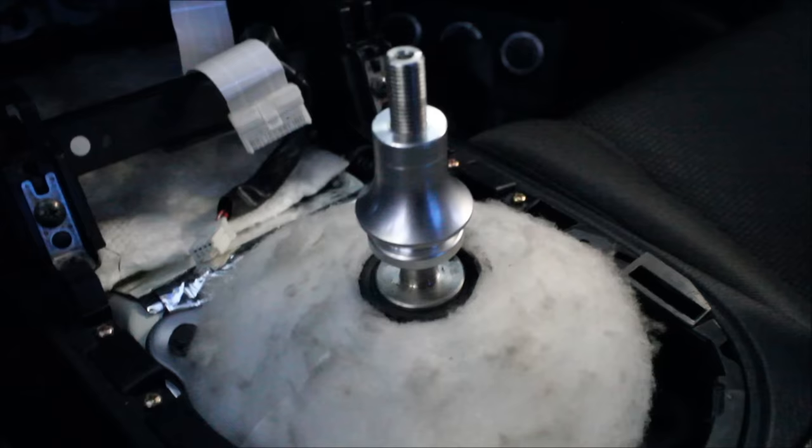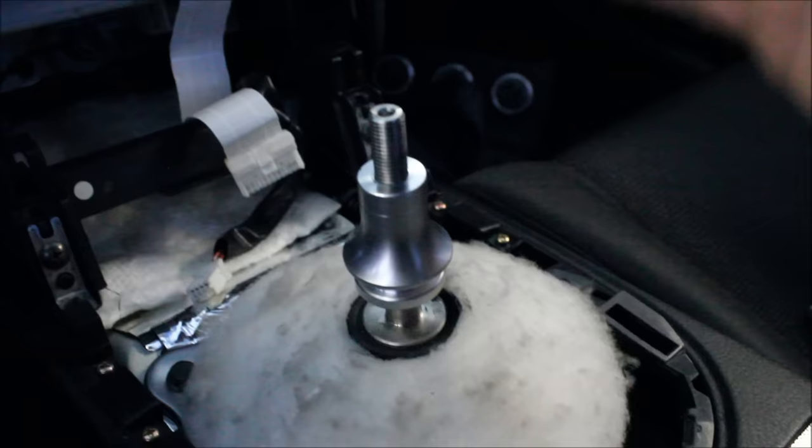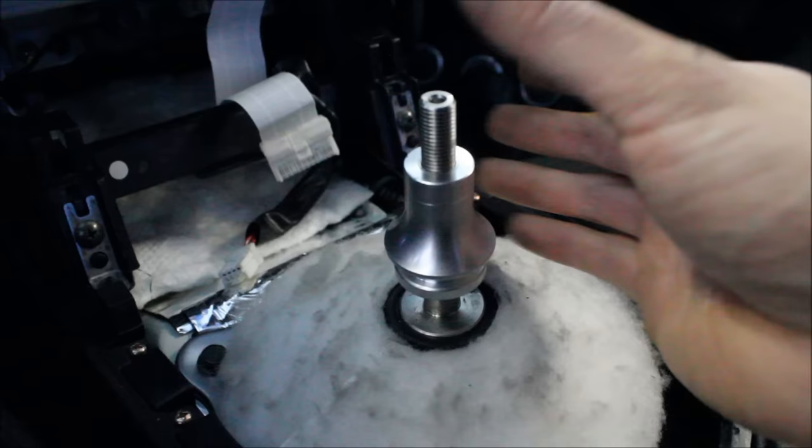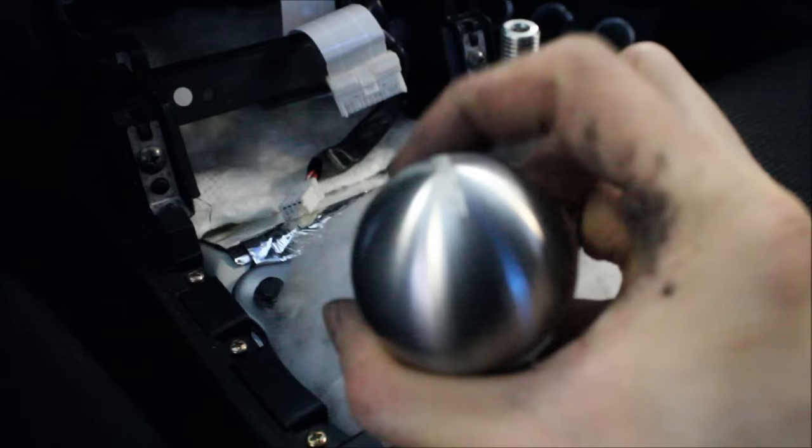I'm almost done. As you can see, I was able to put back all the factory pieces as they were before, so you're not going to have to worry about sacrificing anything. This collar I have here is just to stop the shift knob because we have all these threads. I wasn't a big fan of having the shifter way deep down in the center console — I actually want it relatively close to stock height. This allows me to adjust the height of the shifter. Also, because we have the branding logo on the shift knob, we don't want it to be sideways or upside down — this allows us to stop that and act as a counter-locknut.